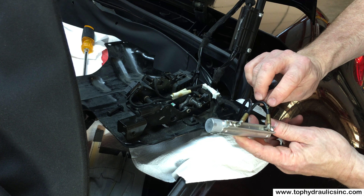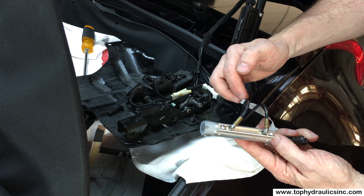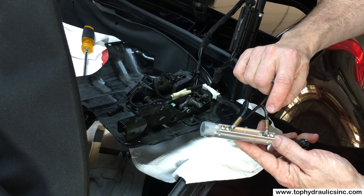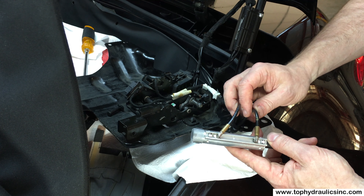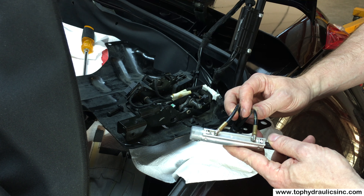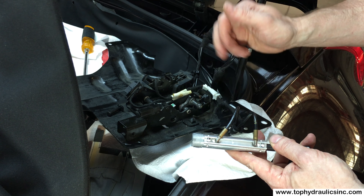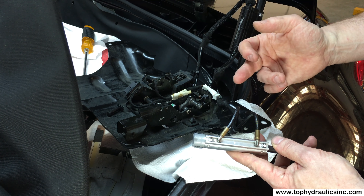These are hose 71 at the shaft end and hose 72 at the blunt end of the cylinder. General rule of thumb: the odd hose number is always at the shaft end. These are the two most commonly failing hoses on the 370Z — easily taken out and traced back to the pump. We've shown you in another video how to take the hoses out of the pump.